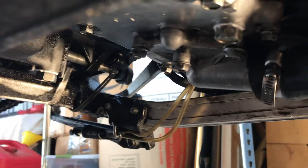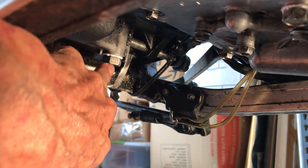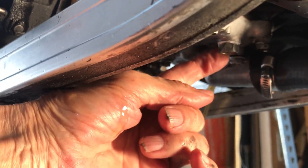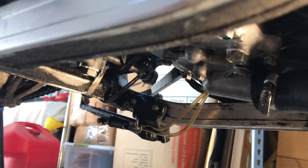One feature of Gammas is that they've got two drain plugs for the transmission oil. The one everybody sees is the big one in the back — you look through the pipes and there's this big plug that looks like the main drain. The one everybody misses is in the front. It's hard to see, up between the pipes, and it's a pain to get out — you need a long extension on your socket. But it's really important to pull that one because it is actually lower than the other one and it's closer to the crankshaft, so it collects more grit.